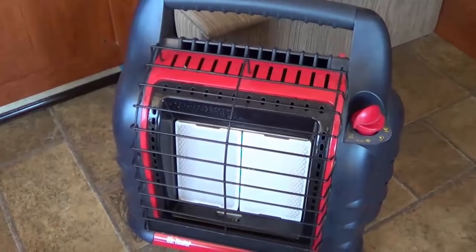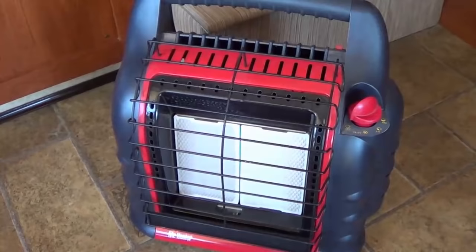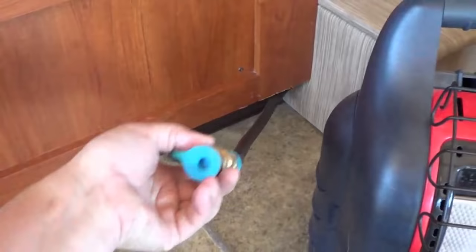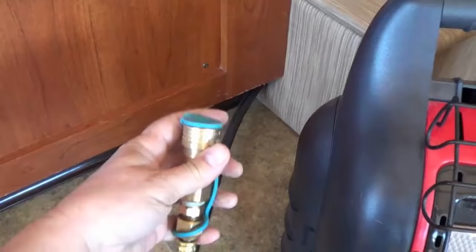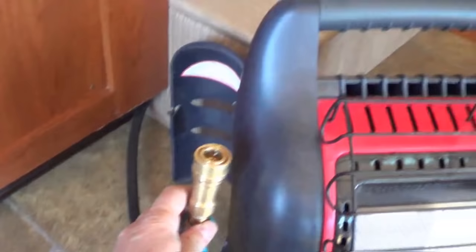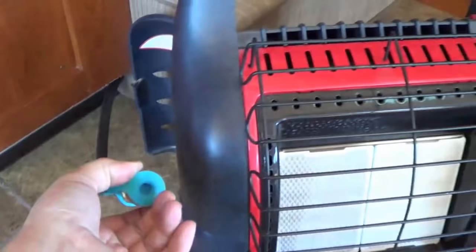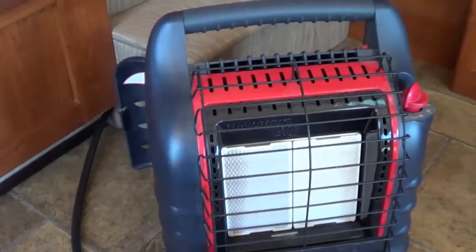Number nine is an addition for the Big Buddy heater. Before I had a tank sitting outside with a hose running in, but I improved on that by installing a quick-connect hose plumbed into the RV's low-pressure propane system, teed in near the furnace. The Big Buddy has a quick connect too, so I just hook it up and within a minute or two we're toasty warm. When I don't need it I just disconnect it and it slides under the stairs, out of the way. It's kind of the best spot in the rig — center position heats everything up.